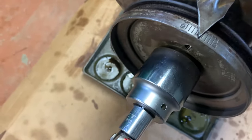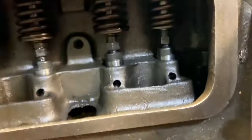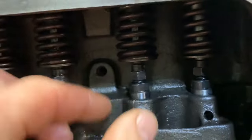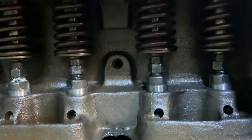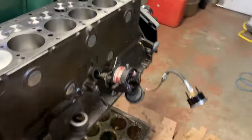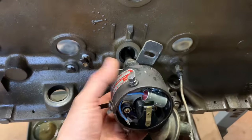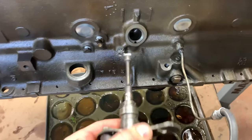And the next thing we're gonna do is grab the two valves. I haven't done a total valve set yet, but we know that there should be valve clearance, tappet clearance, on both intake and exhaust when we're at top dead center, number one piston. So now we've got our distributor rotor lined up here. We can spin it freely because there's a little index key on the end of it there. That's gonna go in the oil pump, right?